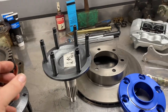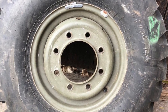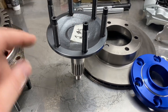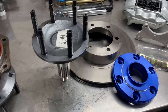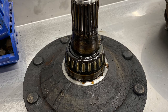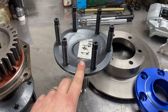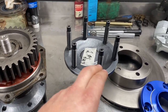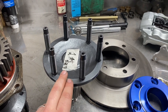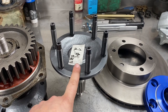The problem with the TDB axles is that they have a really oddball wheel bolt pattern, so it's impossible to find aftermarket rims. What you do is remove this part from your axles and send it to Friedrich Malin or Malin Advanced Mechanics. They machine it down and drill and tap a new wheel pattern — a six times five and a half, which is a really common wheel pattern. So you have a lot of options for aftermarket rims to choose from. You send in your part and get it returned machined and complete.